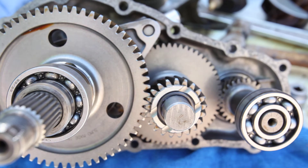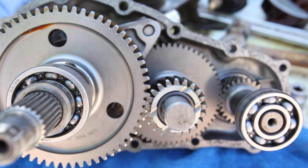I'll share what my experiences are. But I just wanted to show this to you to show the difference between the Trail Gear 4.9-1 and the Sumo 6.4-1 gear set, which is really what your choices are if you've got 31-inch tires on a Suzuki Samurai with stock pinion gears. That gives you your fifth gear back and it's just about perfect.